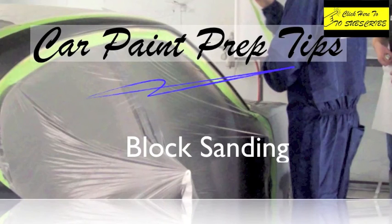If there's a scratch, and you're using a block, the guide coat is going to stay in that scratch, and you can see, well, I haven't sanded all the guide coat off. So I need to either continue sanding. Sometimes you may have to reprime. What you don't want to do is think the main objective is to sand all of the guide coat off, because I've seen many times where there might be some guide coat in a little low spot or scratch, and people start tilting the block over trying to sand it out.